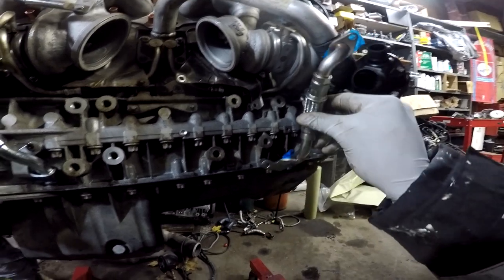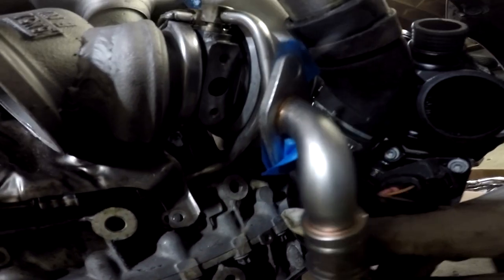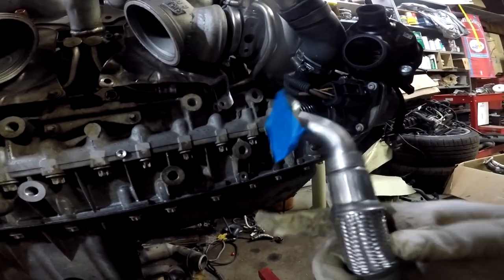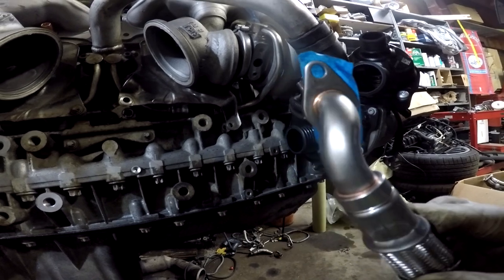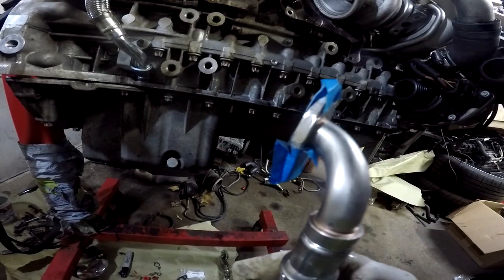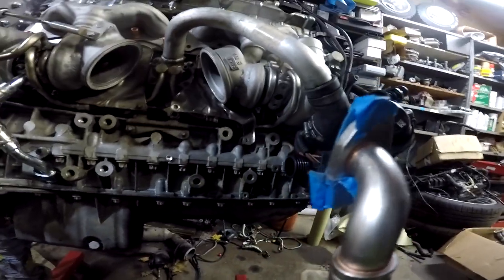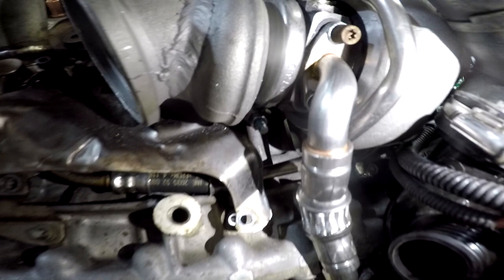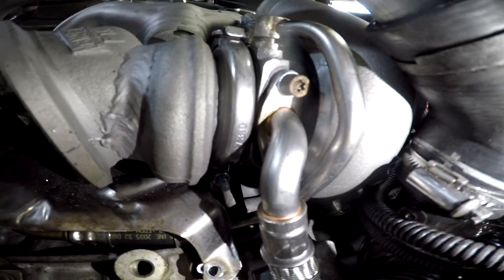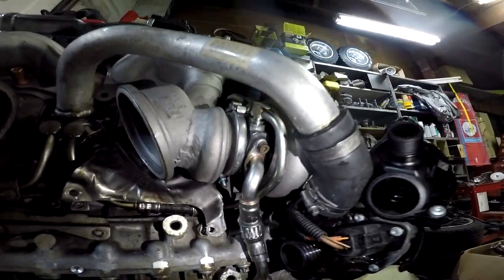This is the drain for the front turbo — it sits inside there and then bolts up there. I'm having a clearance issue between this drain and the v-band clamp, so I taped it up so metal debris doesn't get inside, and I'm going to shave off a little part of this flange. I did a second pass and shaved it down some more. Now you can see the clearance between that v-band clamp and the drain flange — the shaving made a difference. All screws are in place, time to torque them down.